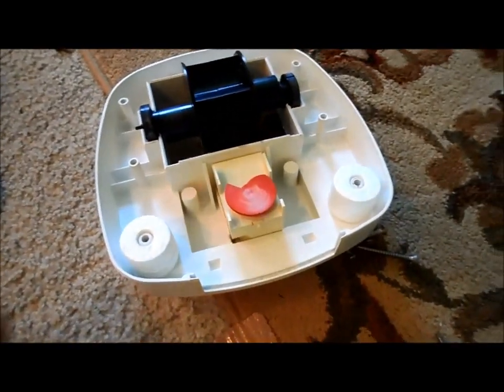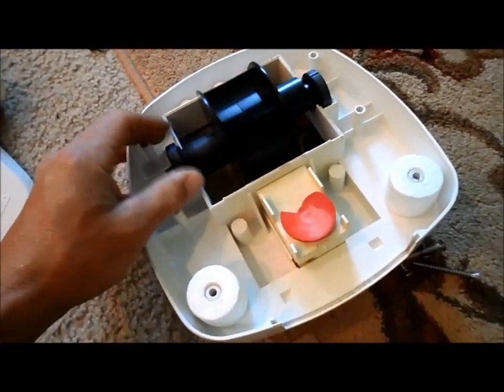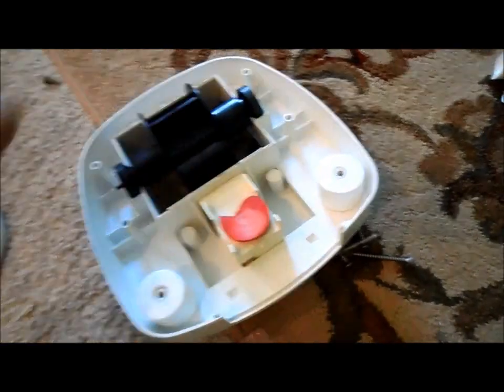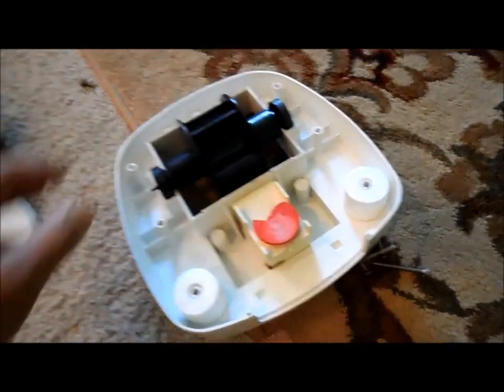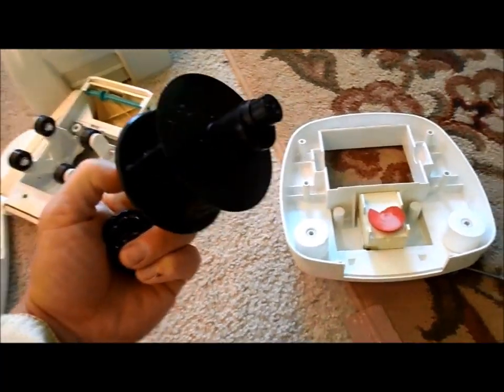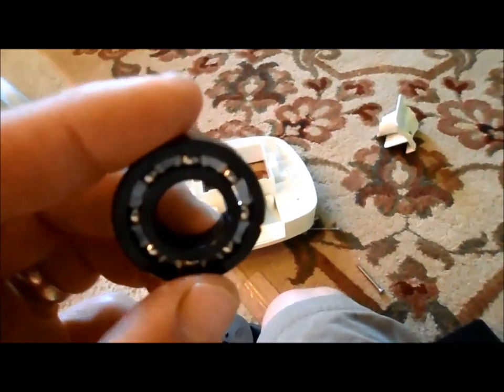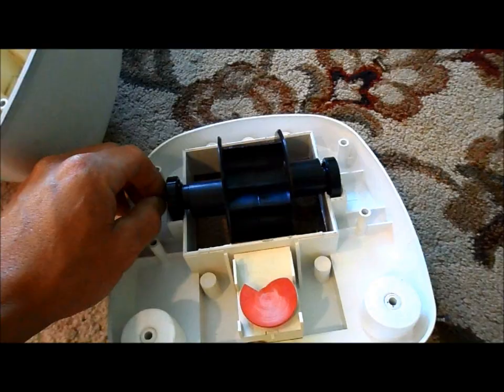Here's the A-frame, and here's the turbine kit. It has two bearings that sit in specific positions — there's a special way to install the bearings, but it's actually very simple. The turbine is marked with an R for right and L for left, so you can't put it in wrong. There's a little notch in the bearing itself and a notch on the housing where it seats, so it fits right over that notch.